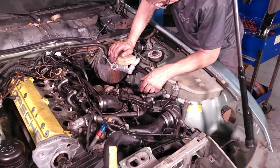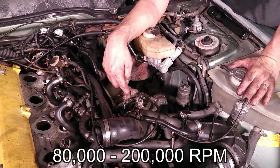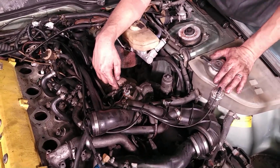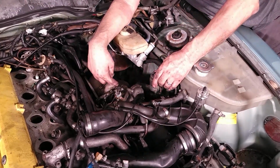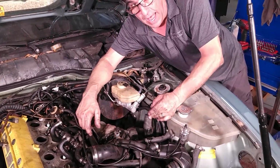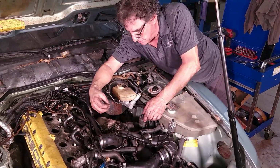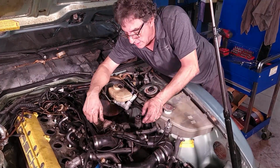Now back to this. These turbochargers spin at such a high RPM, they take a long time to slow down. So when you shut the car off, they're still spinning. What Porsche does, I think a lot of car manufacturers do it, I mainly see this on Porsche though, they also use engine coolant to run through the bearing housing in the turbocharger. This pump runs for 20 seconds after you shut the car off to help cool the turbo down from heat soak. That way the oil doesn't coke up and crystallize inside there and prevent oil from being able to flow. This works great.